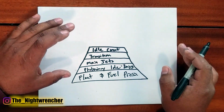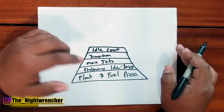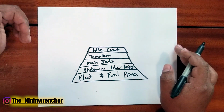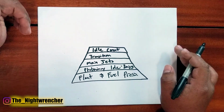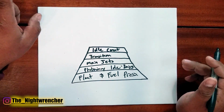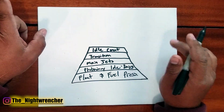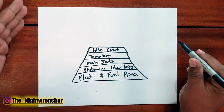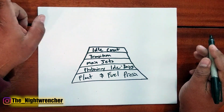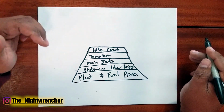The way you set up your power valve, and again, I have a video on this, is you figure out what your main jets are supposed to be, and then you find a hill or you try to accelerate or you try to pass a car. A vacuum gauge is really good for this. You find out where your lowest vacuum reading is or your medium vacuum reading is when you're trying to pass a car or go up a hill. If you're cruising at 14 inches of vacuum and you go to pass a car and it drops down to 10 or 9 or 8, you know to get a power valve that's one step above that.